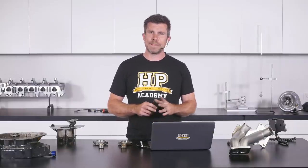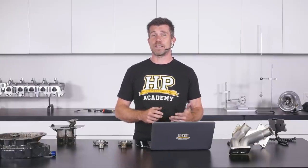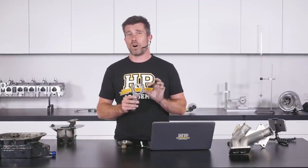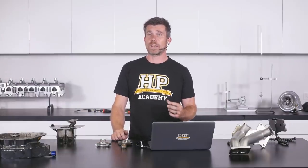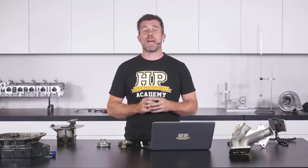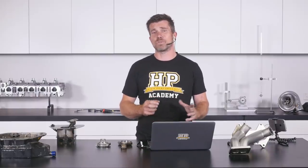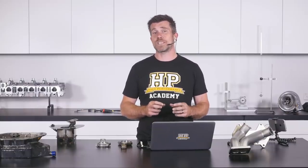In this case the block is still together with our crankshaft in there, and it's only a very basic build just to get us up and running. So what we did was check the big end bore — the bore diameter of the conrod — and we compared that to our factory conrods. We found they were quite a lot smaller. We sent our rods back to the machinist and had them hone the big end bores about three quarters of a thou. We just did a dummy assembly half an hour ago and now our clearances are bang on 2 thou — right where we wanted them. There are a variety of ways of making small adjustments to bearing clearances, and the option you go with is dependent on how far you need to adjust.